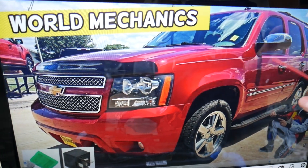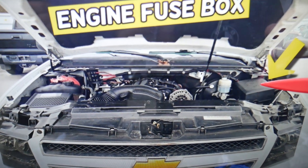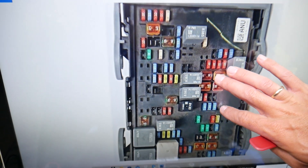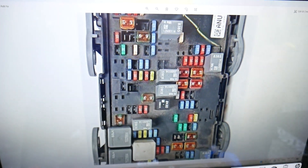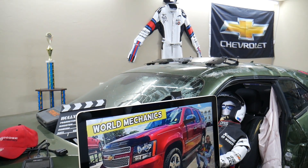You may also need to check another fuse under the hood. Pop the hood open — facing the engine on the right side there is a fuse box under a cover. Once you open it, you may need to check fuse number 44. Depending on the year model and options, you may have this one as well. Hopefully the video is helpful — thank you for watching, see you next time.